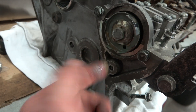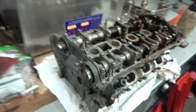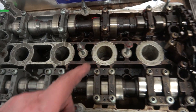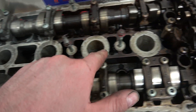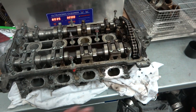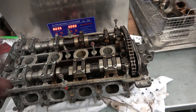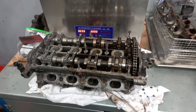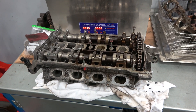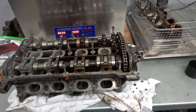You can see all that sludge coming out around the cam position ring, and even down the bore holes with the spark plugs off, this side is clean. It's not going to be 100%, but this is just the first-stage clean. When it's skimmed at the machine shop it'll go through another hot tank solution — double cleaned. After that we'll clean it before reassembly, and once reassembled it'll be wrapped in cling film to keep it free from contaminants while the block is being built.